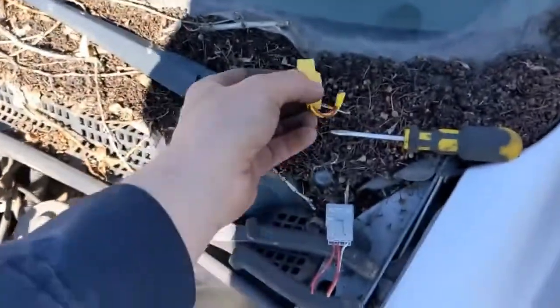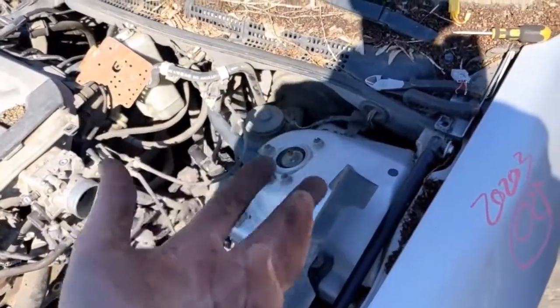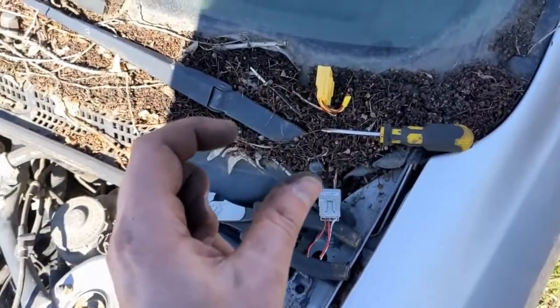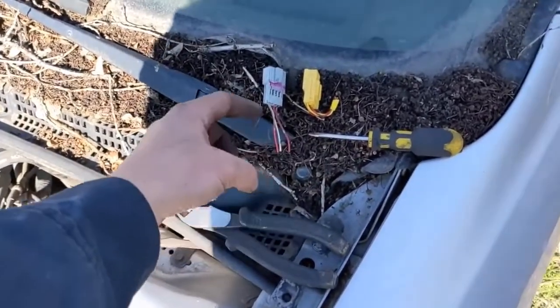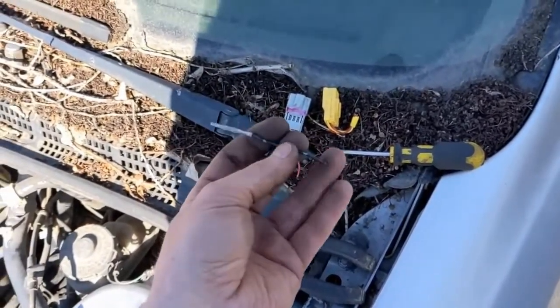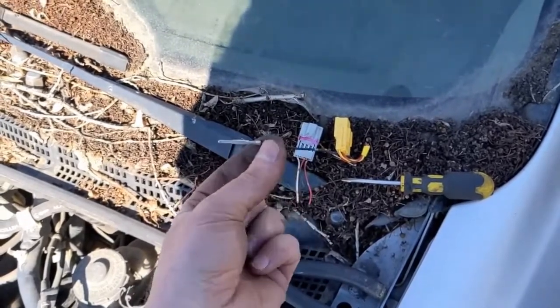That's what's so cool about building your own kit — if you have a vehicle you're working on, just look for harnesses and find the male ends. You can even take home a female connector so you have a set of female terminals for any use you may need. These connectors are only a couple of bucks from the junkyard. Just clip it so you have a lead, take it home, separate the pins from the terminal, and then solder on alligator clips or whatever end you want. There you go — now you have a set of front probing diagnostic test leads. Thanks for watching, like and subscribe, see you on the next one.